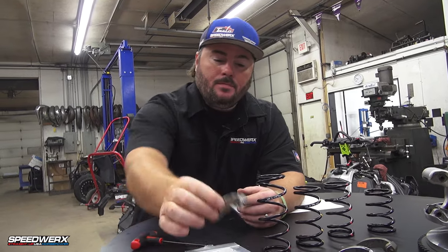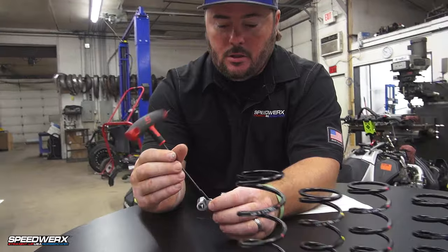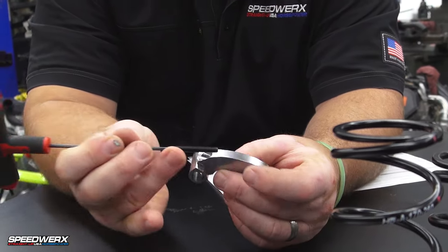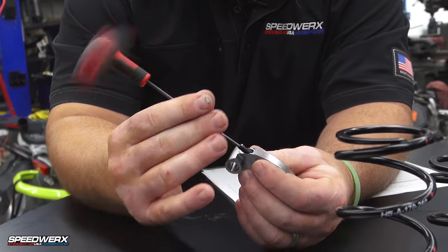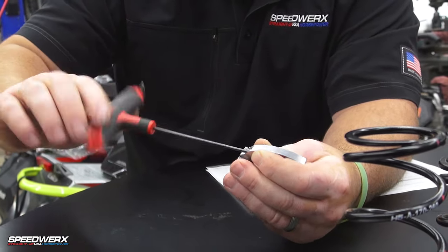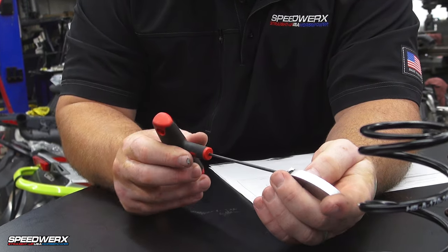And it's adjustable in two spots. One is you can adjust it installed in the clutch with the threaded hole all the way through. So if you want to just have some weight here on the base with a short set screw, you could. Or if you wanted to load it up all the way, you can run this guy in all the way — that's loaded now, that set screw is filling all the way into the clutch weight.